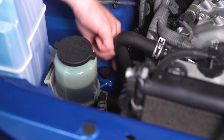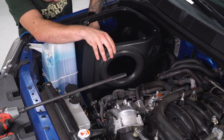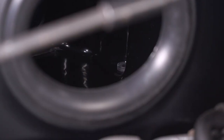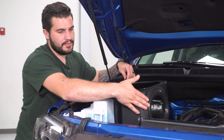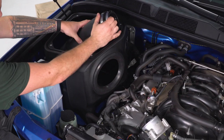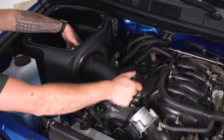Place the rubber spacer over the bolt closest to the front grille, then drop the airbox on, being careful not to knock off that spacer. Bolt it down using 10-millimeter bolts through each of the three grommet locations, plus one more in the middle and one at the corner near the rubber spacer — tighten them all down with the 10 socket. For the tubing, feed it down inside the airbox, rotating it until you get it in the proper position, then swing it out and connect it to the throttle body.